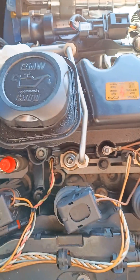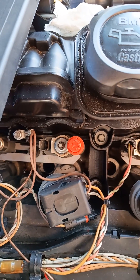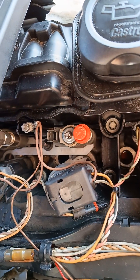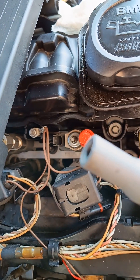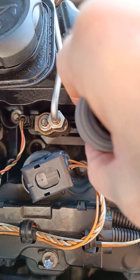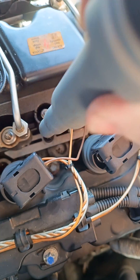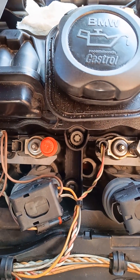Once I've taken that out, I put the new one in place — still got the cap on it there. It's tricky to get the clamp back on and to get the nut in. I found that using an old ignition coil pack works perfectly — it goes over the head of one of these, so it allows you to pick it up and push it through the hole without knocking the plate out of alignment.